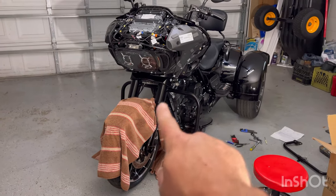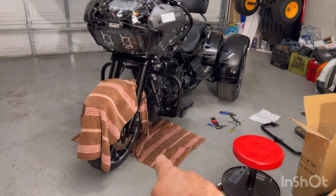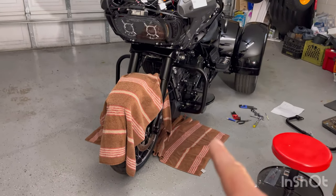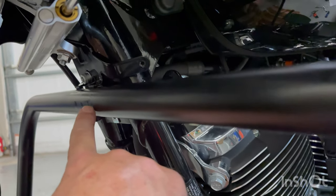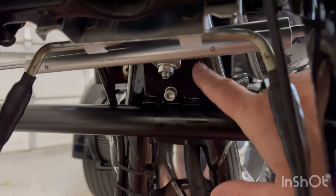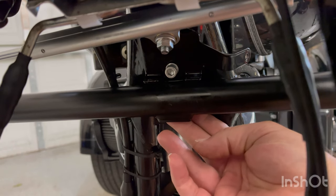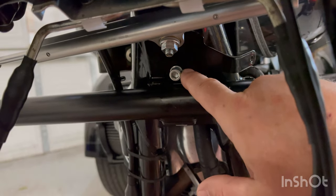When you're doing work over your gas tank or fender, please put something down to protect it. I put a towel down on the ground too to protect the engine guard while I was installing it. Another thing with the engine guard: there's a top lip on top of the engine guard bar that actually sits behind the plate in the frame. It mounts through a hole that Harley already put in there. There's a hole behind this bolt, a hole in the plate welded to the frame, and a tab on top of the engine guard that slides up under that plate and is threaded so you can thread through that hole to mount the bracket.